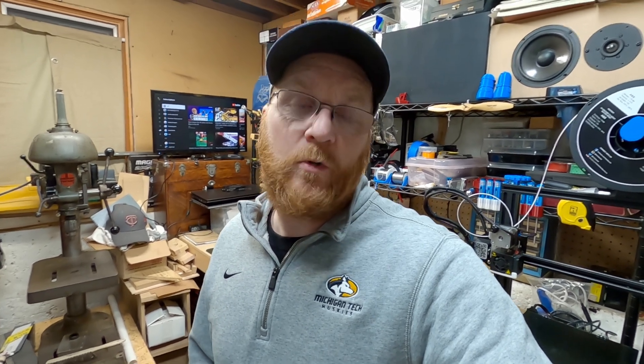I'll show you a couple of things I've been working on. I've got the ImmersionRC Ghost external module for my Taranis and I've installed the receivers in a couple of quads. Since Ghost came out they've had some firmware updates and I've been trying to keep track of what they are and keep everything updated. What I wanted to do recently is update OpenTX to the ImmersionRC version they've got for Ghost, and also update Betaflight to 4.3 so I could use the Ghost protocol on the receiver tab.